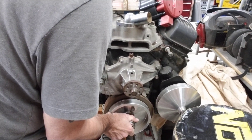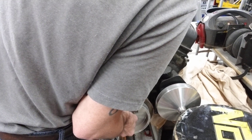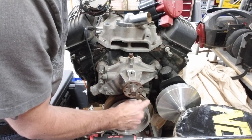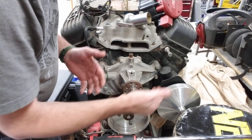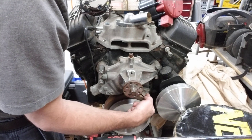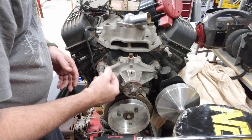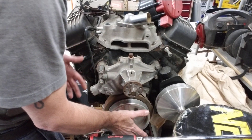The reason I like to do it this way is because some motors — like this one with this balancer — have no advance marks, just a pointer and a mark. So you can really only tell where it's at by going zero to zero. A lot of aftermarket pointers are just a single pointer. You can have ATI balancers that will have timing marks on them and do it a little differently. But this is what works for me and it's always worked great. Right now it's on top dead center compression.